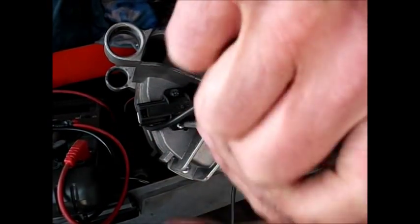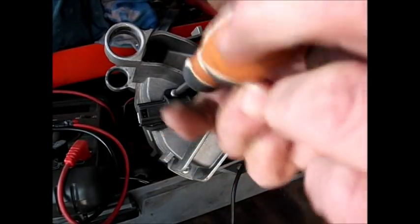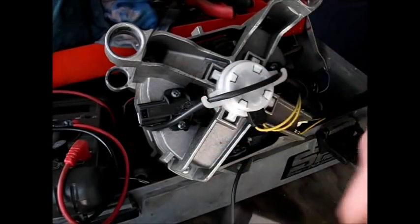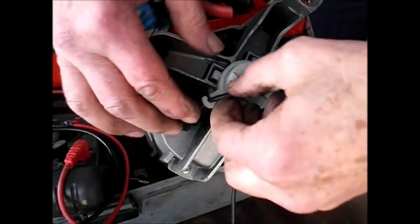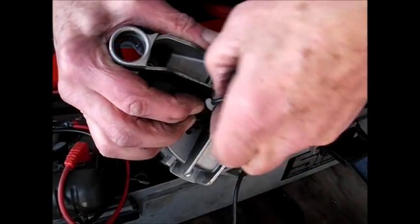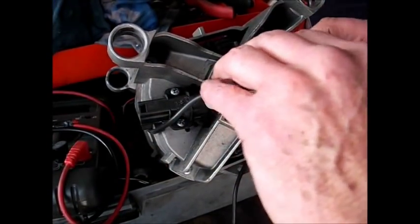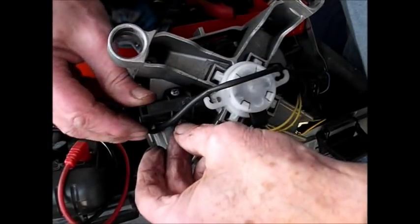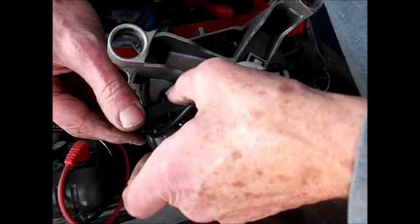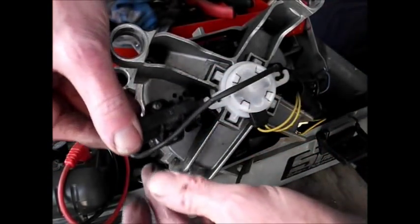It's just that this machine has got another fault on it, which I suspect is in the module. And if that's the case, I'm certainly not going to bother, because that's going to cost me 50 quid for a module, and I'm certainly not going to take a chance on 50 quid. So we'll just unhook this here, and get this monkey out of here, and this one out of here - there's a bit more room to manoeuvre. We'll take the brush out, and I'll show you what I mean by the brushes being off-centre on the commutator.